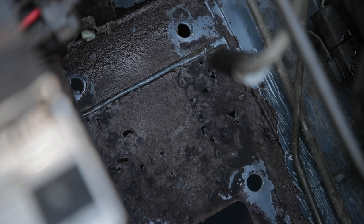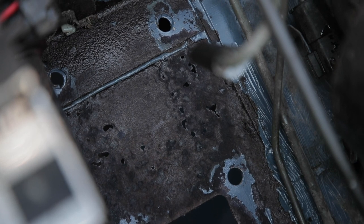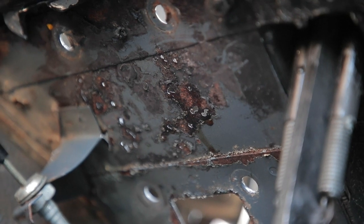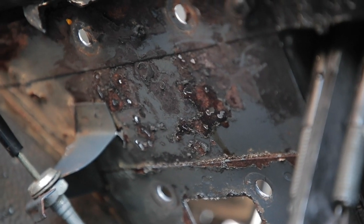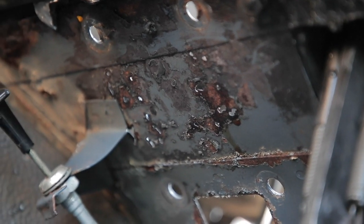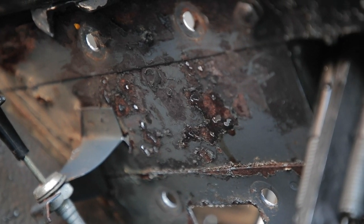As I was cleaning it I found these little holes — the pressure washer pushed through. I'm used to it, so I'm going to put a bit of chemical metal on there to fill them in. You can see them a bit better from this side — just a few little pin pricks where the clutch pedal assembly's been pressing up against there. Maybe a bit of fluid got on it and it's just eroded away over time. I'm going to put some tape on the back and put some filler on the front.